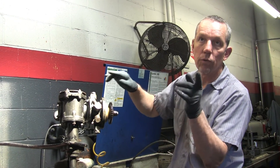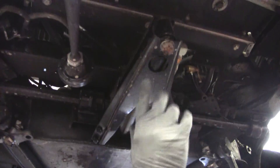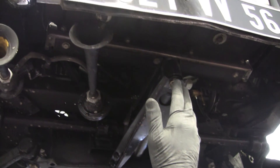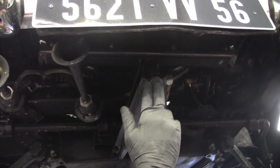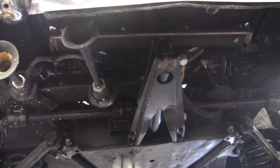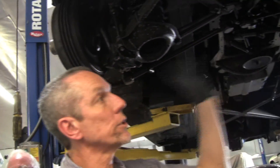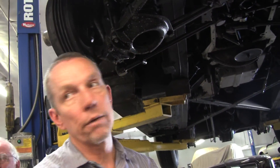These two hoses here go to the steering ram. What you have is a piston assembly out here — it hangs out in front, so it tends to get bent a lot from parking things. Those hoses go to either side of this and they help give your steering linkages the boost it needs. The steering box still turns the linkages, but this gives it the added boost.